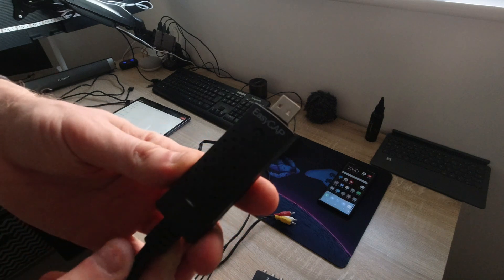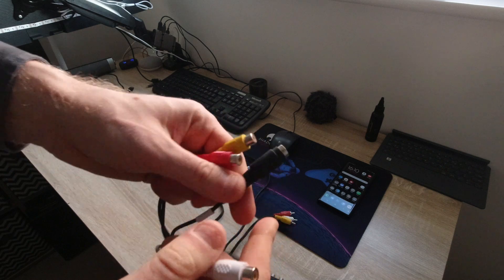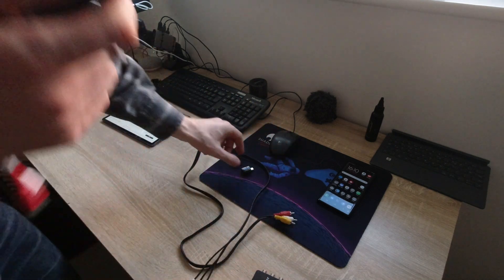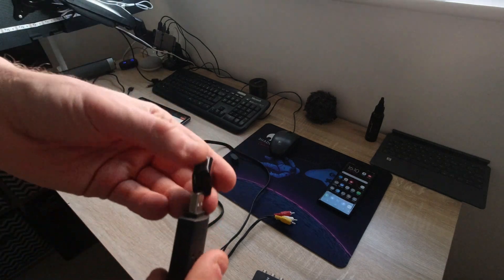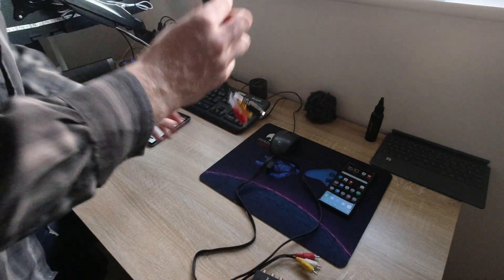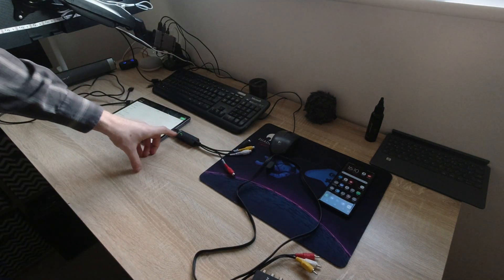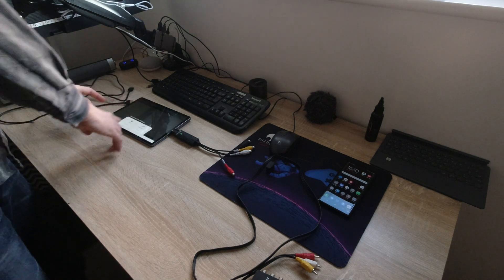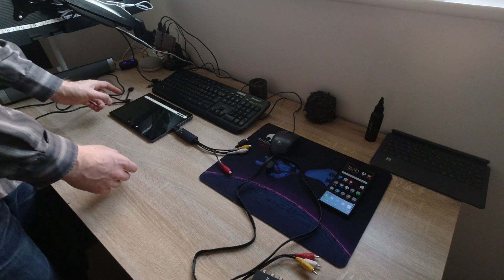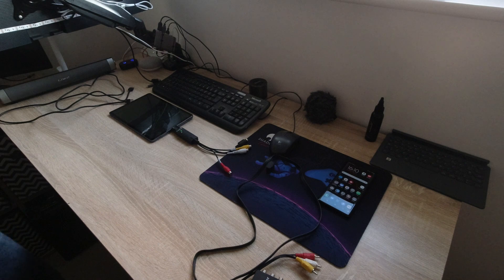To get the analog signal I will use this. This is called Easy Cap USB analog — red, yellow and white — RCA cables to USB. And to connect that to my tablet, I need a USB-A to USB Type-C OTG cable. So technically, and hopefully, if I plug this in, the light comes up. Yes! And it says use FP Viewer. So I opened it up and now it's showing a black screen. Is that good? Bad? I don't know. We're going to find out.